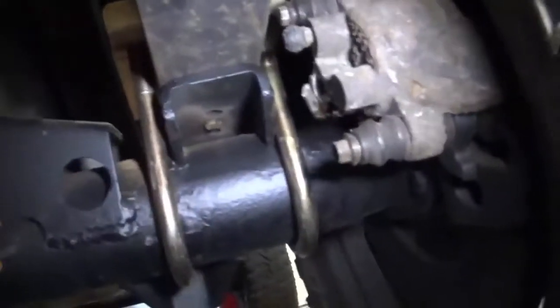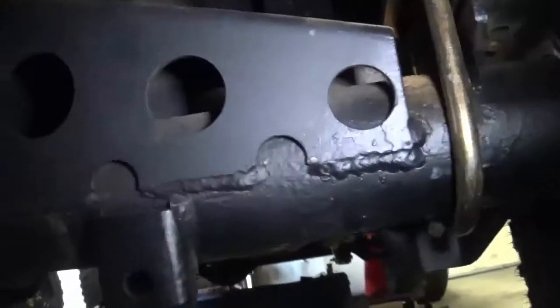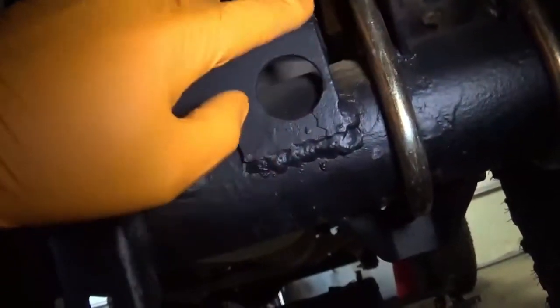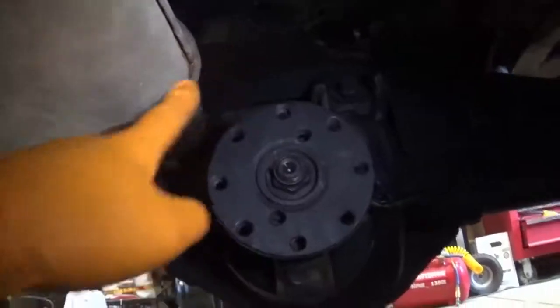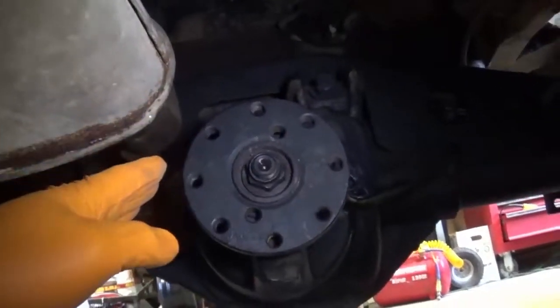That is way far off. On top of that, when I first put the weld on the perches, it was way too close to this truss on this side — to where I couldn't get this on and this on at the same time, so I had to cut it. That was the first red flag for me. Also, when I put it in here going around the front with the stock exhaust system in here, you can see how close the pinion is already to the stock exhaust — it was basically almost dead nuts touching it. So it was not correct at all.